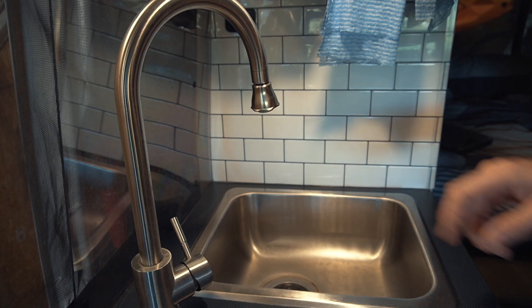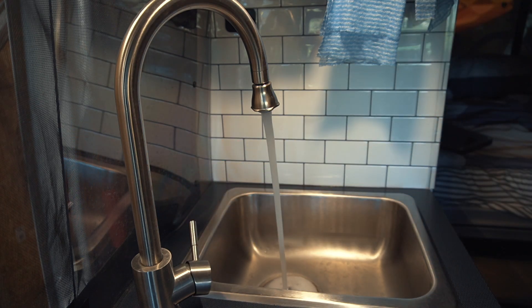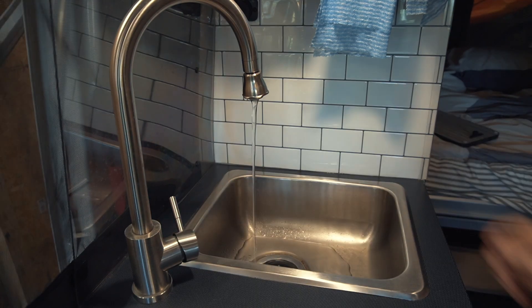The Revel has a very decent water pump. If I'm turning the faucet on all the way, it starts pumping and runs continuously to provide a nice steady water stream. But if I turn on the faucet only a tiny little bit, the pump shuts off and on quite a bit. This is expected because the pump always runs at the same speed and would produce more water than what's coming out of the faucet, so the only way to regulate the water stream is by short cycling the pump.